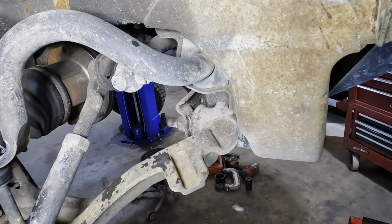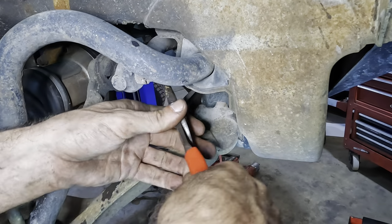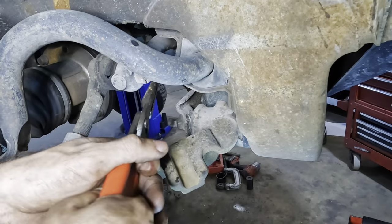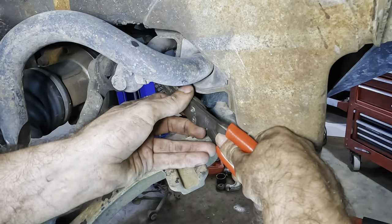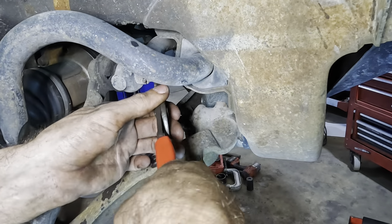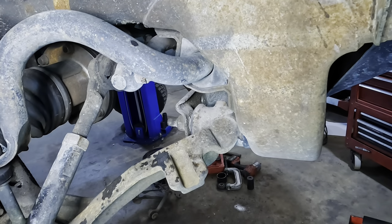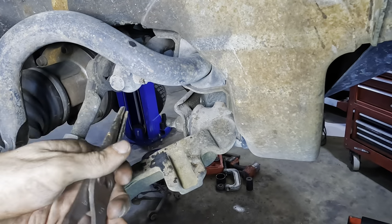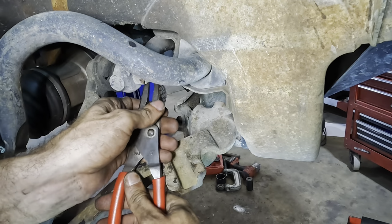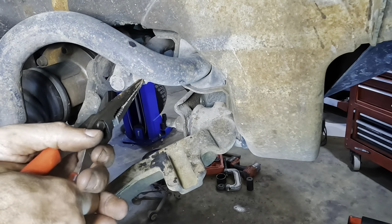Well, I still don't have any ball joints yet, so let's continue disassembling. I'm gonna pull these outer tie rod assemblies out and we're gonna change these with some new ones as well, because the ball and socket joints in the tie rods were remarkably crusty and not in good shape, and I'd hate to do a halfway kind of repair and not address these other safety items. So these are also going away if I can manage to dig this cotter pin out. It's stuck.